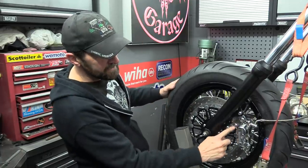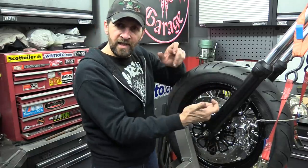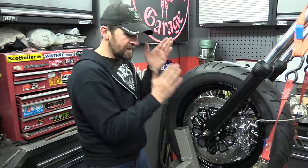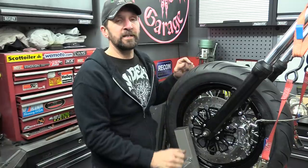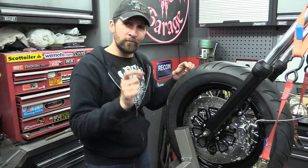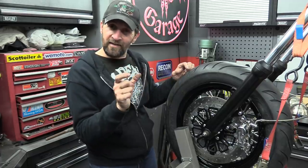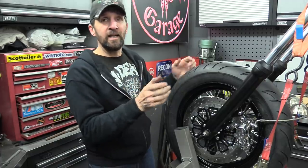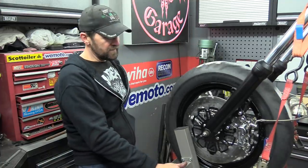Not quite, I've got to paint this little bracket here, so take that off. Same as the rear one, the bracket that holds the caliper. I've got to put the disc on the rear wheel next, get that alignment correct as I did with this one. And if it is, and that wheel is perfectly aligned, then there's a big fat spacer on the rear that currently is all corroded and horrible. That won't do, so I'll make a stainless steel one of those, even if it has to be the same size. And while I'm doing it, if there is a little misalignment, I get a chance to make it bang on and get the same result as this.